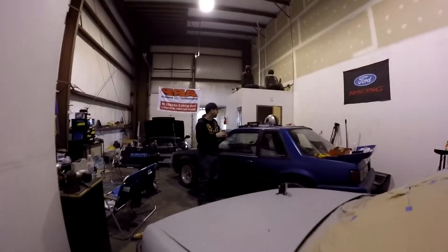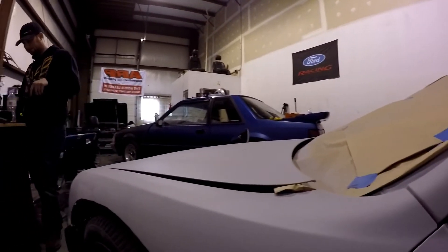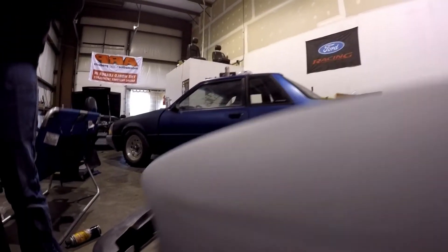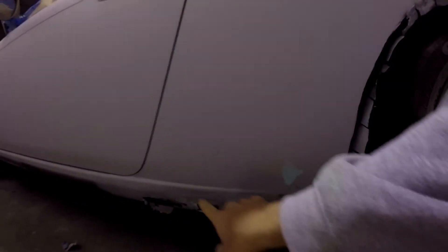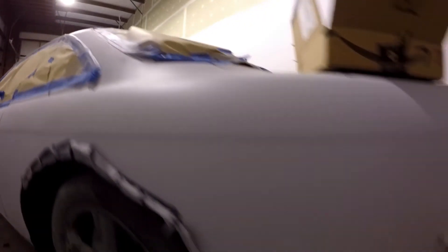Another day — we're going to get the body kit on the driver side, all put on. Found some more packets, one more packet of M6 rivserts that we're going to use. Jake's here and he's having Mustang problems, but we can go into that after. We're going to throw the front one on, doing the same alignment thing as last time — take the corner piece, line it up, drill one in the corner, drill one over here, then drill all the other ones and we'll be good to go. Rear's all good too — this still needs to be cut out but we're just going to mount it on and mark the holes first. Going to try to set up the GoPro for a little timelapse.